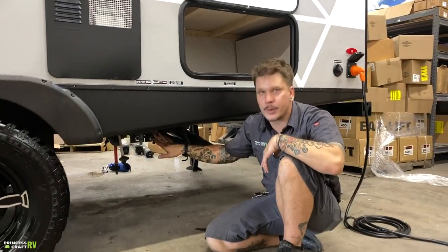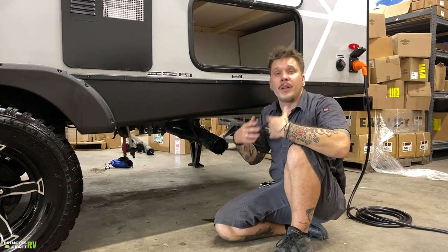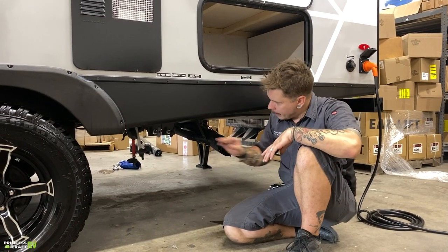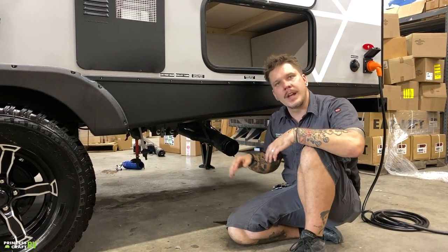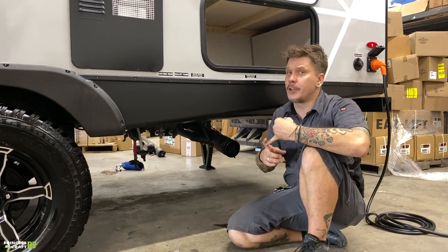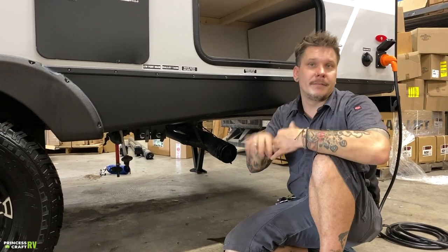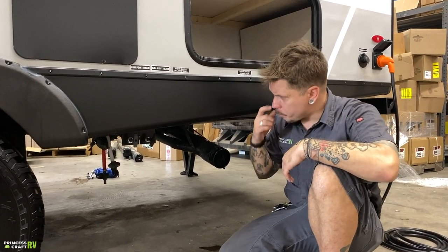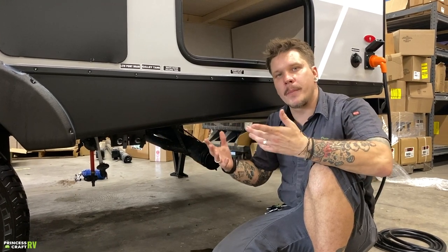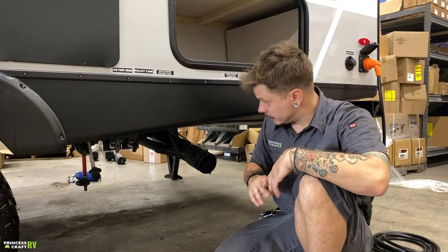Very important, especially with this black water tank, that we allow that to fill up, and we want to keep that in as wet or flowing condition as we can. So we keep that valve in the closed position. We do nice long flushes. We use a single ply RV grade toilet paper. We use a chemical treatment and a deodorizer, things like that. So keep the black water valve in the closed position. Again, we want to make sure that we are not plugging that tank up with that solid body waste.